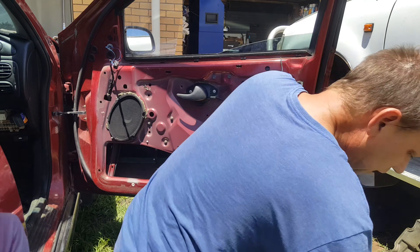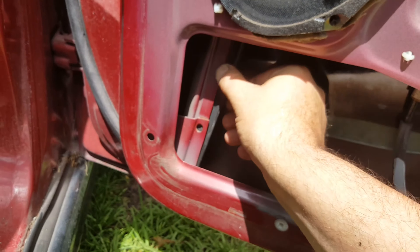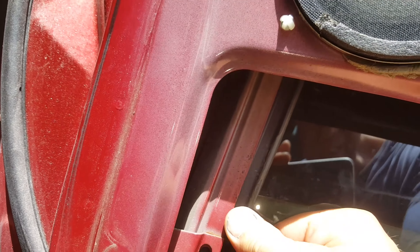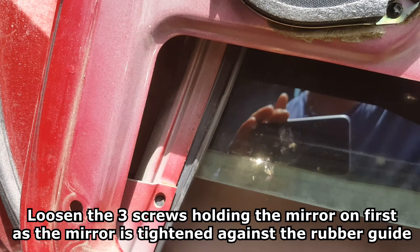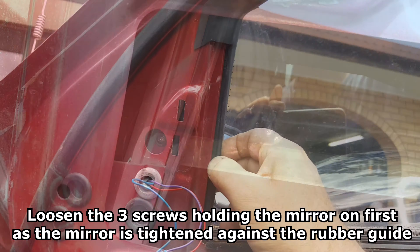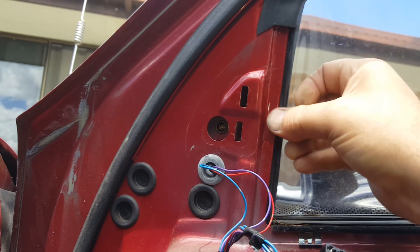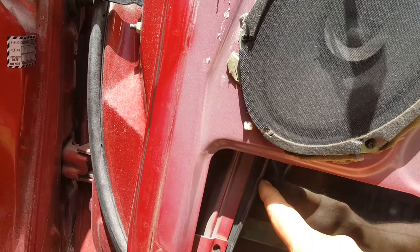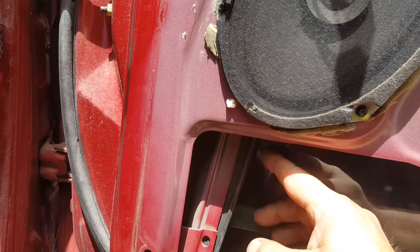I found the problem — I'll show you this close up. If you look on the inside of the door, that centre point is designed to move like that, nothing's loose there. But what I've discovered is the rubber here has come out. So what I'll do is take the rubber out — window down is the best way to do this. It's a bit difficult with one hand but I should be able to just pull that out, then give it a clean up and slide it all back in, making sure that rubber goes back into where it's supposed to be.